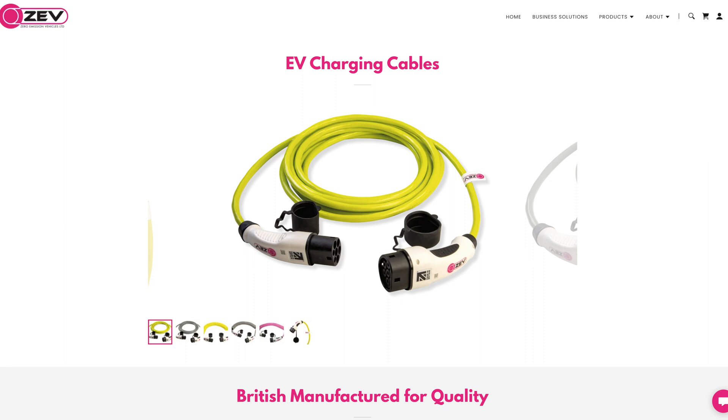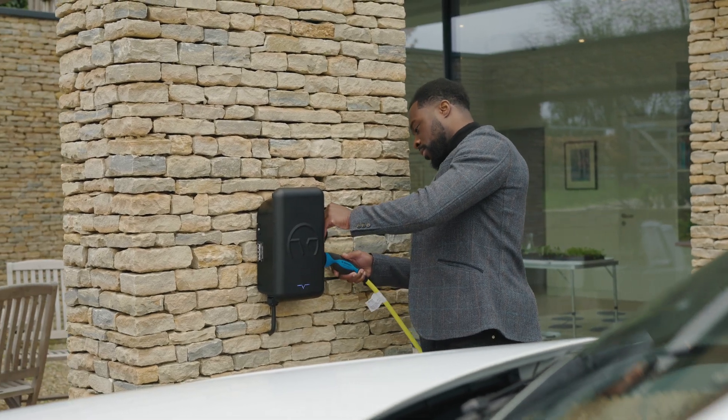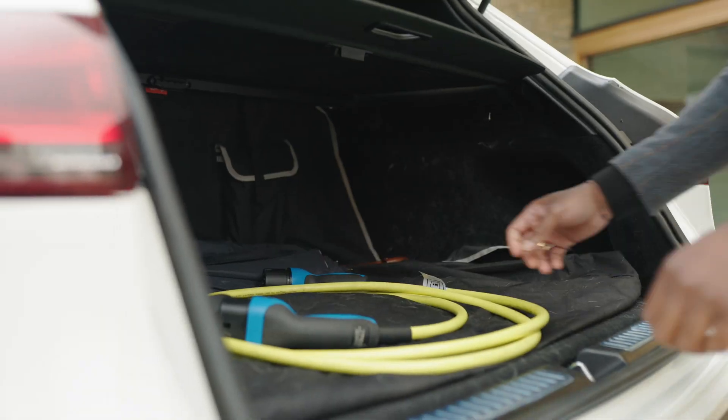And then you're going to look at the length of the cable, which is the other variable. You can either have coiled or straight — coiled being a little bit more convenient for packing away, straight being a little bit cleaner when it hangs off the vehicle. So if you're looking to predominantly charge at home, you're going to want a single phase charging cable, still 32 amp. Then you pick the length, colour, and configuration yourself.